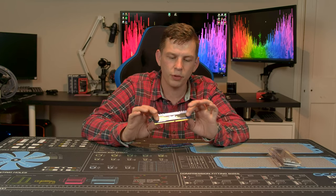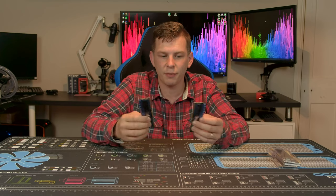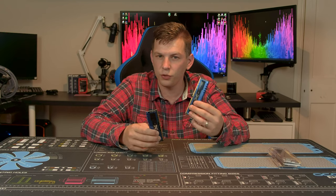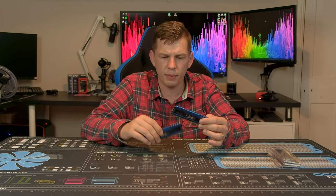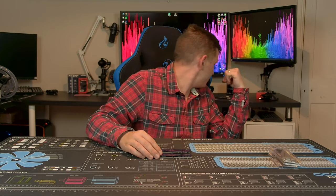What I did was go online, rummage through photos of these sticks, find a picture of the bare PCB, and google the part numbers — which confirmed Samsung B-die ICs. B-die is the cream of the crop for overclockers because, as long as you keep it cool, it overclocks well. It doesn't like being hot, but it will take high voltages with no issues. This stuff can go up to 1.4 volts; these particular models run 3200 CL16 at 1.35V.